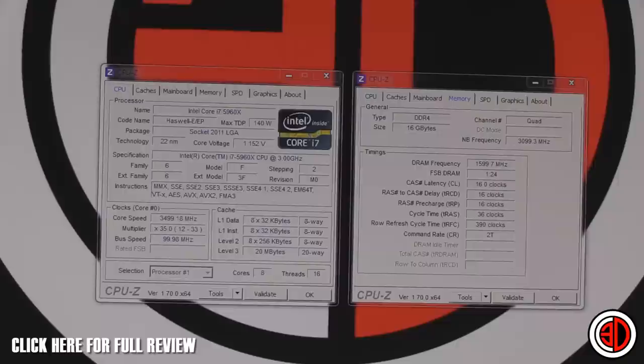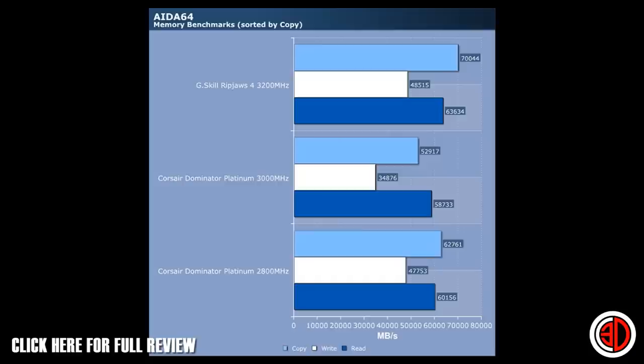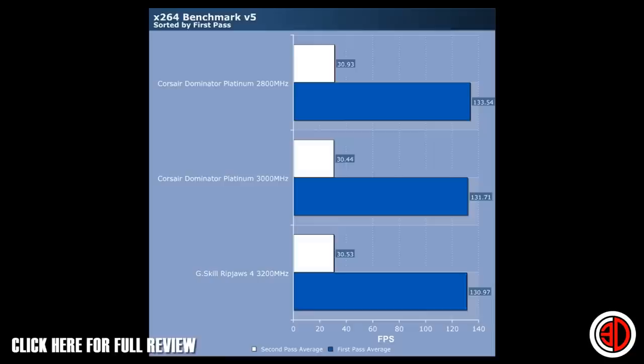It's almost like on Z97 with 2400 MHz memory you could have the same overclock throughout, but here with different base clocks and different tie-ins it makes things more difficult. As you'll see in the Aida graph, everything is in order — top is fastest. We've got the G-Skill Ripjaws 4 3200 MHz at the top, then the two Dominator Platinums beneath: 3200, 3000, 2800 MHz as expected. But when you look at the x264 benchmark, it's completely the opposite — the 2800 MHz with the 127.5 base clock is at the top, 125 in the middle, and the 100 base clock at the bottom. So in that benchmark it's completely reversed and more CPU-dependent.